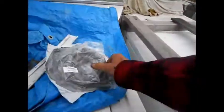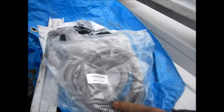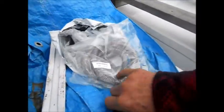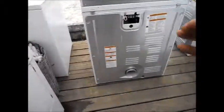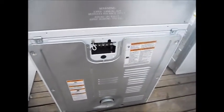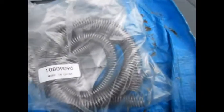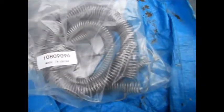I just put that with a couple of screws. But the heat element has gone out on this one, so we're going to restring the heat element. This is your heat element and we're going to restring it on. These heat elements are only like $7 a piece. If you buy the whole thing plus the shipping, it's more like $20. No big deal, but I'm just going to show you how to save a couple of bucks with the restringing heat element technique.